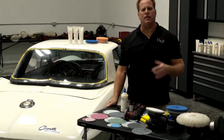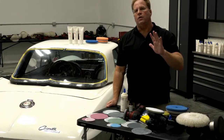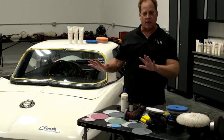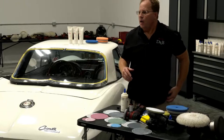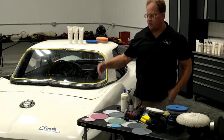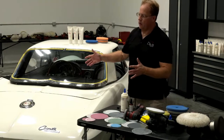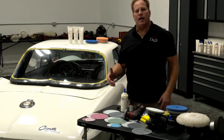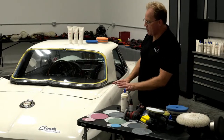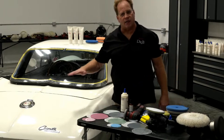In my car detailing classes, we always clay the paint on the car we're going to sand down before we sand it, because in most cases, I'm bringing in cars like this 55 Del Rey back here, or this 65 Corvette. They got custom paint jobs. The paint is thicker. But while that vehicle is in the paint booth, a lot of times when they finish painting, say the lower panels, some of the dry spray circulates around, lands on the car, so it's got texture to it.